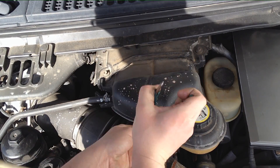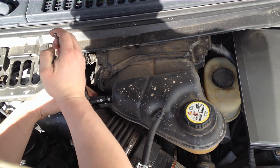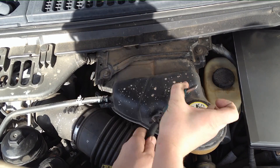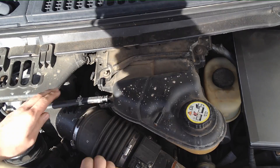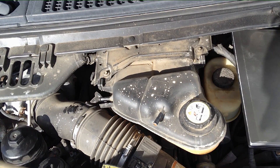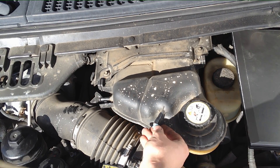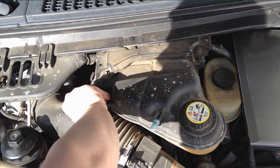Got our lines — make sure that's tight again after you pull the pressure out. I'm going to loosen these, pull them off, and come to the side. Make sure they're pointing upright so they don't start leaking on you, because they'll do it silently and leak all down your engine the whole time you're doing this. We're going to cap this bottle off — it's about three-eighths, there's the size on there.